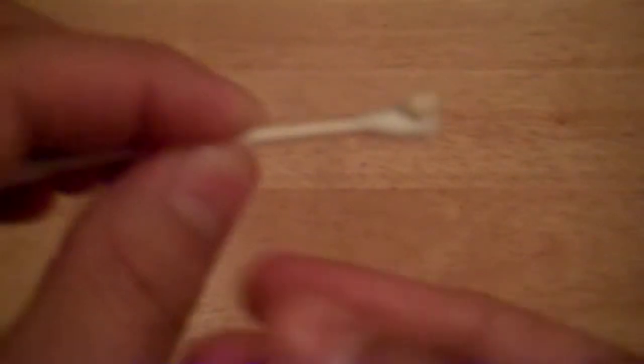And so it'll save you the hassle of completely taking apart the Game Boy cartridge from this screw right here alone. Now you can start applying a tiny drip of Brasso onto the Q-tip and start cleaning away in the cartridge.